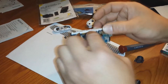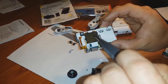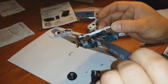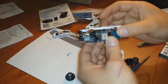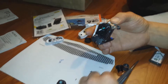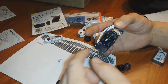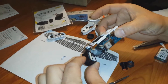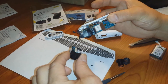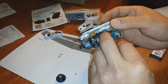As you can see, there is a wire right there — a data wire that connects to the LCD screen. I decided not to disconnect that; it's going to be a pain to put back in. But it's loose enough to where the sensor assembly just kind of pops out. Pop the microphones out — don't leave them in there or you'll rip the wires. Make sure you know which one's left or right. And then this wire right here was connected — that pops out easy, and I assume popping it back in is going to be much easier than dealing with the LCD wire.